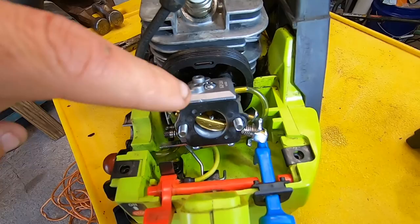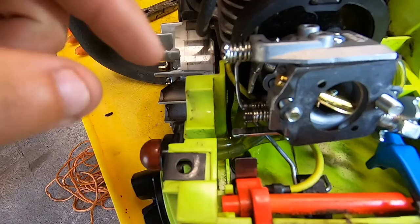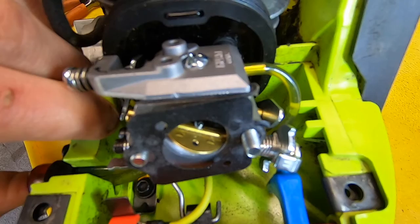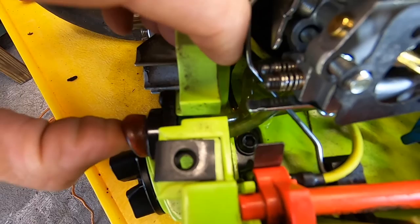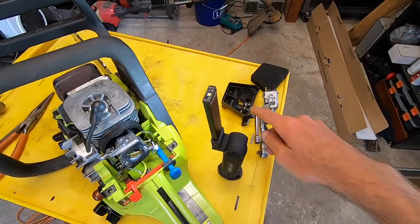Before I get everything totally buttoned up, I put a little bit of fuel in the tank because I want to show you guys exactly how this is supposed to work. This is going to draw fuel up into the top of the carburetor, then it's going to come back down out of the bottom here through the primer bulb, and then return back to the tank. So if you guys watch this fuel line here and go ahead and squeeze — you can see the fuel is running up, priming through the primer bulb, and now you can see that fuel returning back to the tank. That's how that is supposed to be set up.